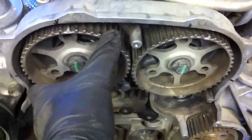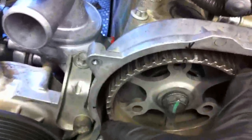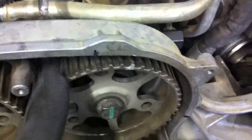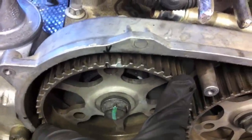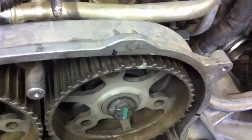I've got the gears back in place — they're not torqued down yet. There's nothing that keys them in one place. I'm putting them back and aligning them with the marks I put on, just to make sure I keep the right number of teeth in between the belt. There's a little bit of play here, and if I went one way on both gears, I could end up with one less tooth in between them than I'm supposed to, and everything can wind up a little off. When you put on the cam gear holder, it should keep the cam gears in place with the correct amount of timing between them.